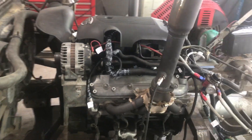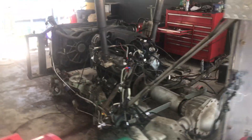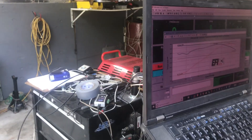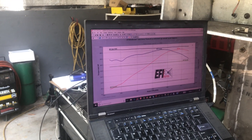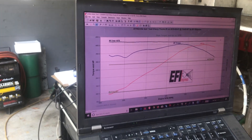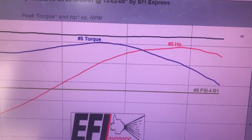We just got to finish tuning it — it's running pretty good. The second gauge I showed you next to the motor, just for reference, is the fuel pressure gauge. That's what you need for fuel pressure to keep this tune happy. We need about 58 non-boost pressure on a vacuum reference.